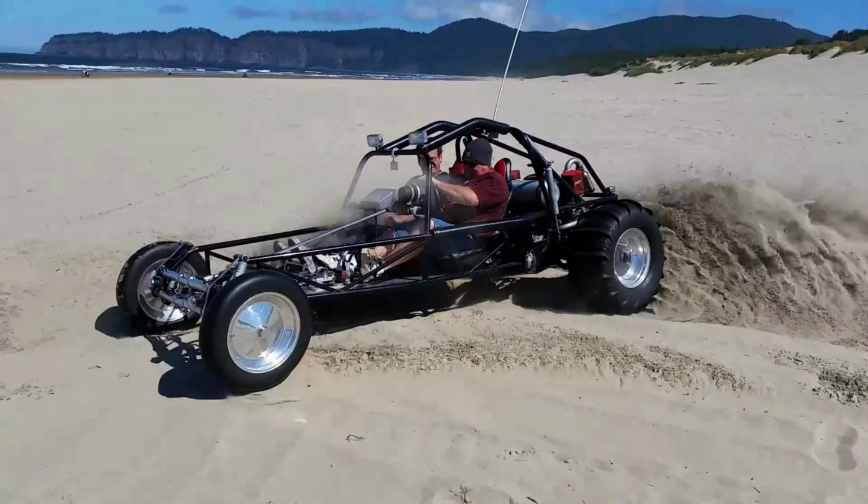Alright. Bought this on eBay. Has a part number on the box of 930-355-01103. So this part number is for a 930 23 millimeter bore master cylinder. Yeah, the pictures were really good. I couldn't really tell that there was a whole bunch of electrical tape on here, but that kind of makes sense since they just didn't want the fluid leaking out. But this looks just like the same master cylinder, which is a 19 millimeter master cylinder, which is a smaller bore. Let's take this apart, see how honest the seller was.